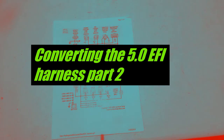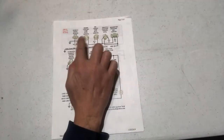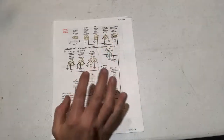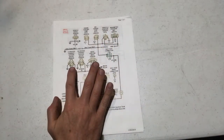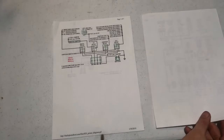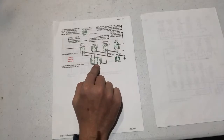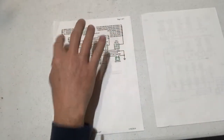Hey YouTube, this is Anthony with the OM this channel. We're back on our project of converting the Ford 5.0 HO EFI harness to standalone. In our first video, in the description I linked to some drawings we'll be using. This first drawing is of our sensors — speed sensor, coolant temp sensor, air temp sensor, exhaust oxygen sensors, the mass flow sensor, and then our injectors. The second drawing, sorry it's so small, covers the relays we'll be adding to our EFI harness — four relays, power distribution, and a description of where our wires are connected.